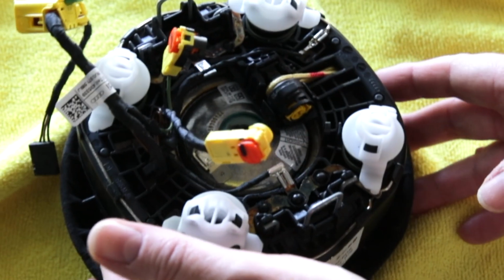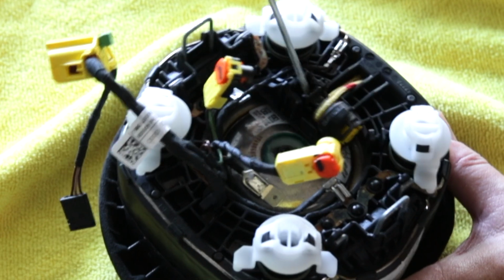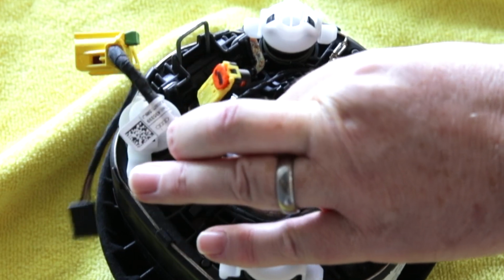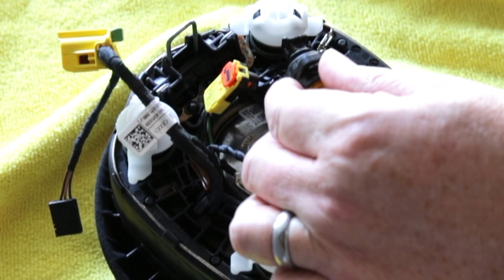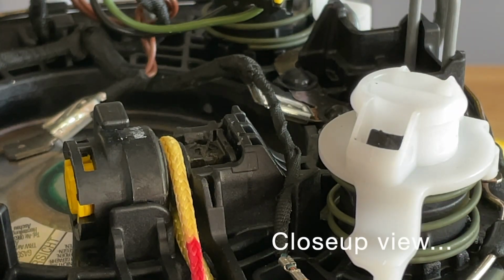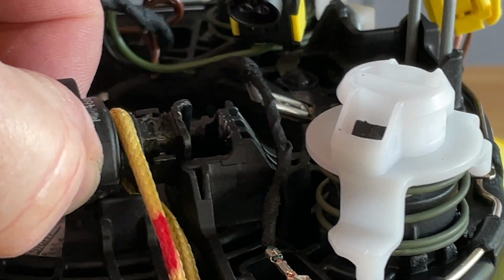Here's a close-up view of what I refer to as the gotcha connector. I examined this puppy for about an hour under magnification before proceeding forward with a very haphazard plan. By using a small flat blade screwdriver, I was able to push the plug forward and out of its receptacle. The entire unit is held in by 2 plastic tabs which have a bit of spring to them. It's impossible to get needle nose pliers in from the bottom to compress them enough for the plug's removal. This is not something you want to do multiple times, as I'd imagine there's no replacement for this piece if I were to break it permanently.